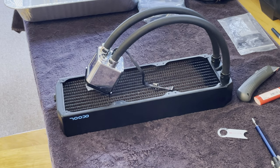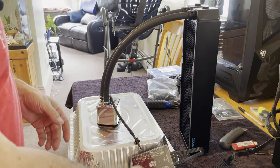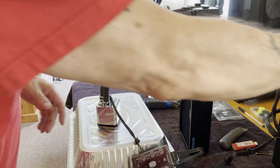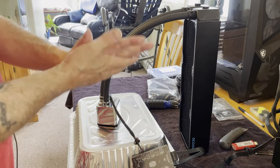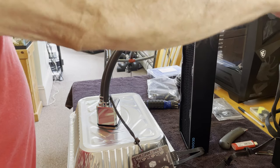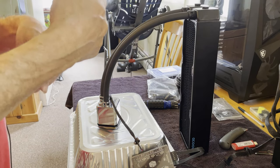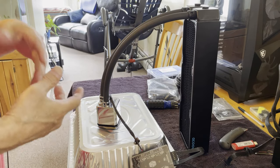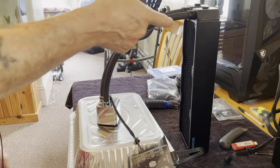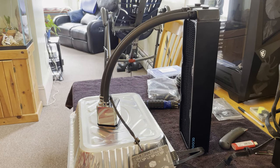All right, cross my fingers. I'm good at powered up. What I did, ran my loop, worked out the way they said, but I did go on and order a 24-pin that plugs into the motherboard, and it's got a loop built onto it, $4.99. You pop it on the top of a PSU, and it does what I just did, basically, without having to make your own wire. So just a little handier, a little easier to keep around.